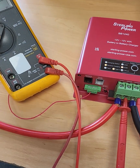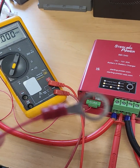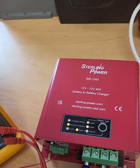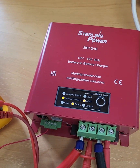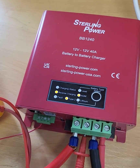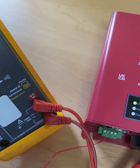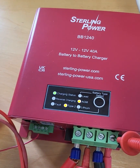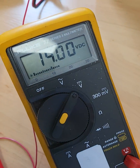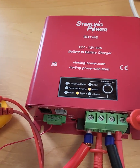One of the beauties with the ignition-fed capability of the battery-to-battery charger — because this is essentially connected to your ignition — I'm just going to mimic it by giving it an independent 12V. So I've just given it 12V now, so the reverse charging LED should turn off straight away, which it's done, and it's reversed the situation to be charging up the leisure battery again. So it's charging in the opposite direction, trying to put 14.4V onto the leisure battery, which is what it's trying to do.